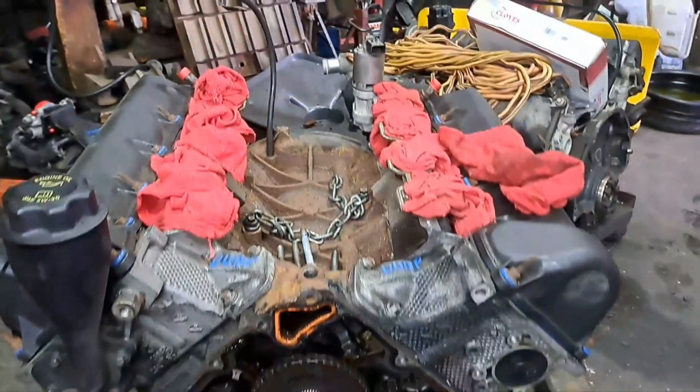We're a little deeper into this now. I've got the valve cover, rocker arm cover, camshaft cover - whatever you want to call it - off. On this side I can see the guide is just completely gone. I'm going to show you what I do to mark stuff. I use white-out and some other methods. I'm going to rotate the engine clockwise.